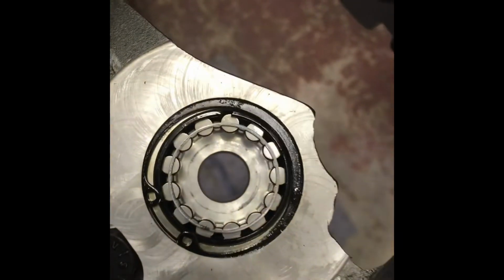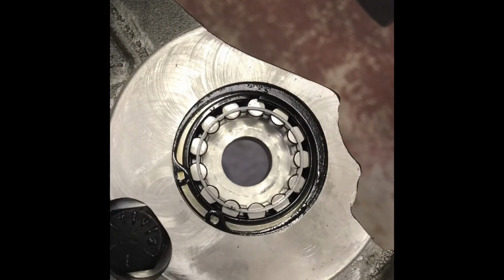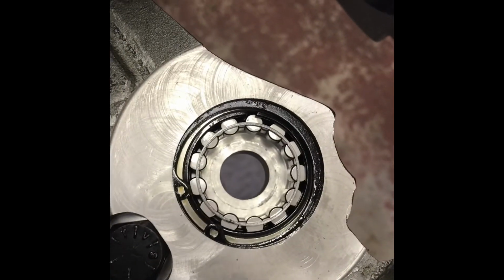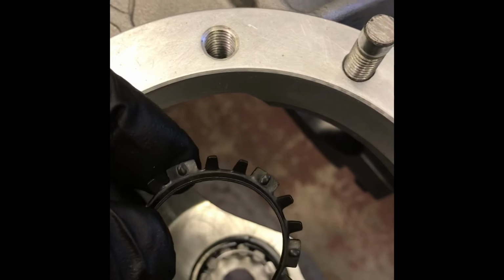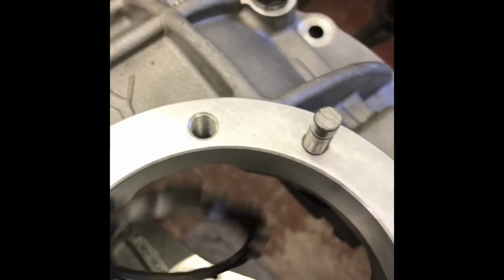I spoke before about that tail bearing. That's a support bearing for the back of the pinion. This case has a nice snap ring that holds it in. That's never going anywhere. This is what Ford uses, this tanged washer, and you just drive it in on top of the bearing and hope it stays there. That's a hunk of something.